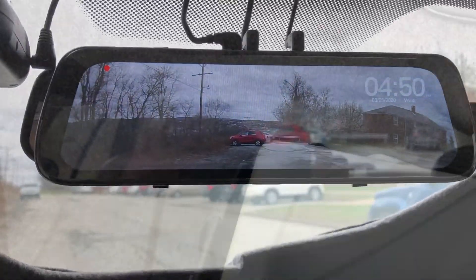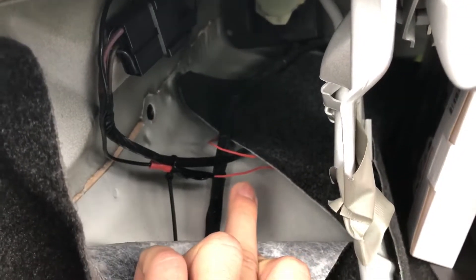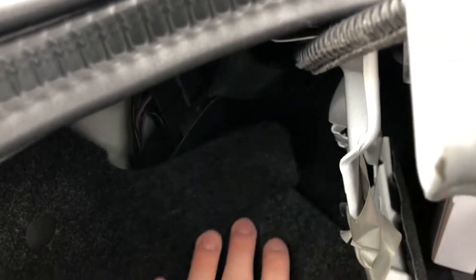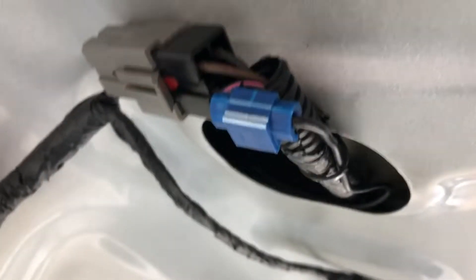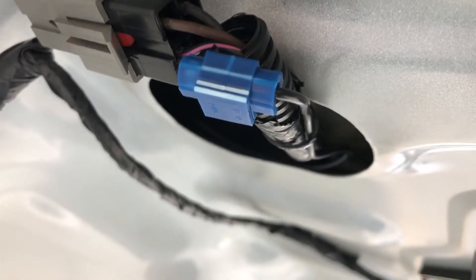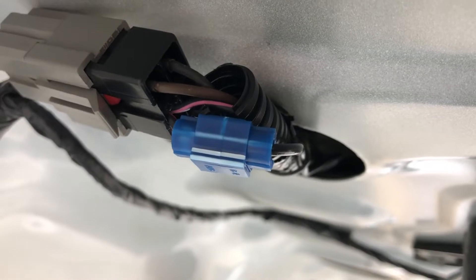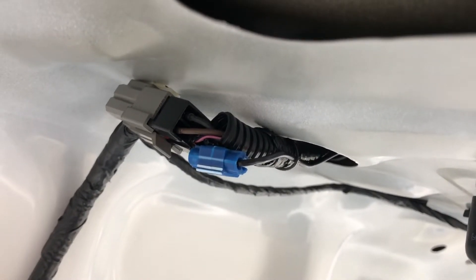I'll show you how I did that. Since I wanted to do an interior camera mount — it's very optional, you don't have to hook the wire up, but I just did anyway. Mine, since I have the cable ties all in there, you only get like two feet of that little tiny thin red wire. So I extended it — I think all they had was 18-gauge black wire, and that black's a little more concealed. You might need something to push up in here to guide it. If you have a repair manual of a more popular car you can probably just Google it. Then you'll splice it into the reverse lamp positive for this camera — you connect to the positive. That way you don't have to go around testing if you know what color the manual says. That's how you get the automatic reverse function.